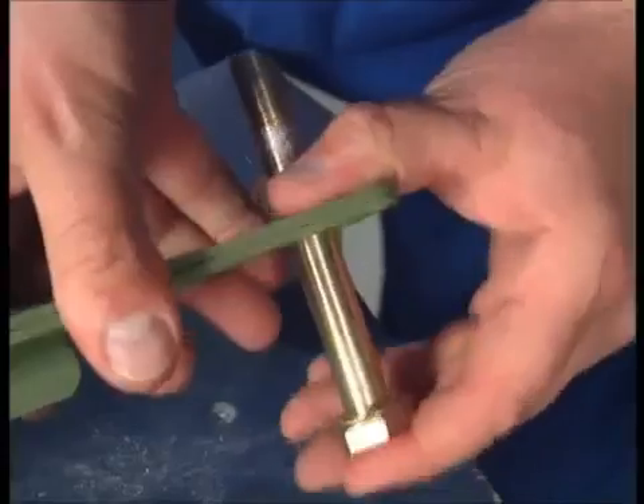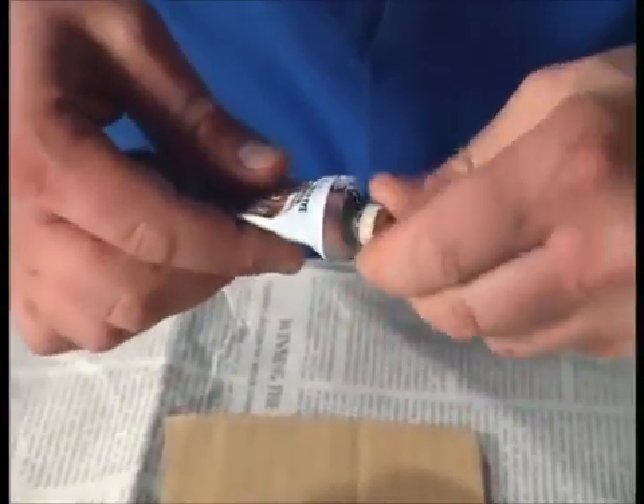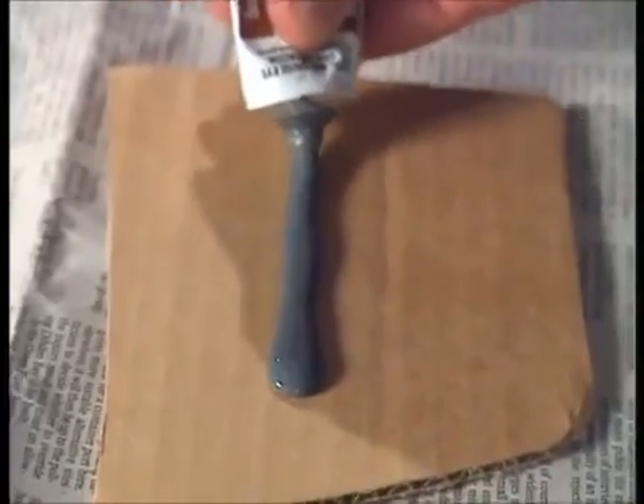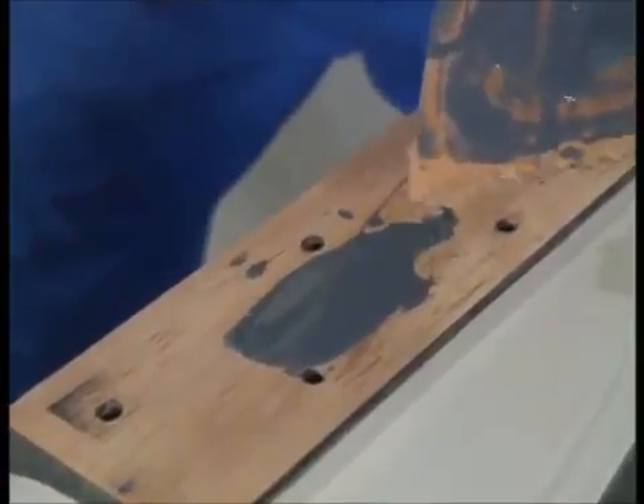Hold on, sit on the edge of your sofa — this plan is going to make it all crystal clear. Right, I've just got to work out how this all goes together. The whole point is you've got to think about this when you're doing it, because you are the builder, you are the engineer. So if you can't work it out, maybe you shouldn't be building one. It's an epoxy adhesive that's going to glue these straps onto the wood — you need three parts of Part A to one part of Part B. You don't actually need that much because it's a fairly thin film underneath each strap. A very critical part of your helicopter is held together with glue.